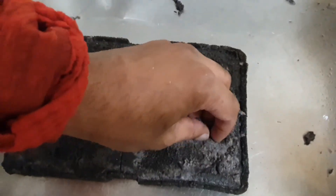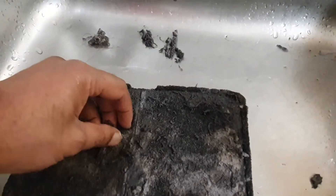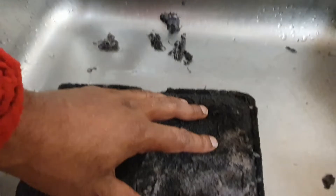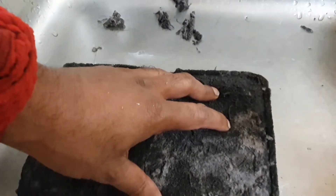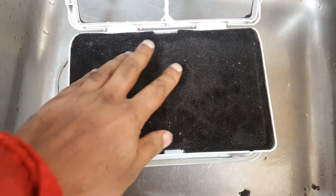It's going to take a little bit of time for that to soak, and we're going to get this as clean as we possibly can. It's always a good idea to have two of these foam paddings so you never feel rushed to get this back into the condenser dryer. And there you go — that's your filter put back on.